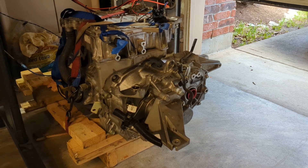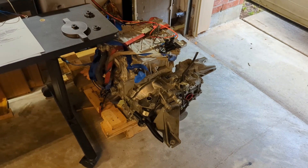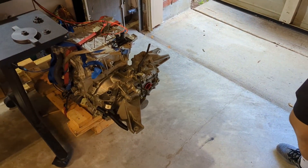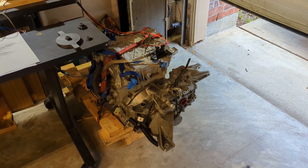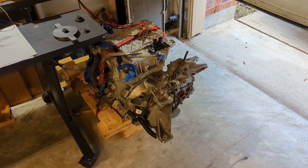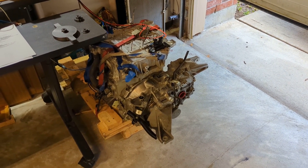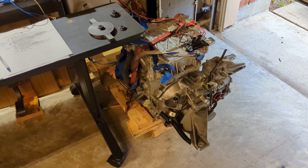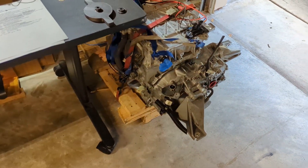The question became how do we get it out of park. We did some research on the motor thinking that if it's a simple DC motor interface, we can just drive the motor. But everything we found suggests it's not — it looks like it's some sort of brushless motor with pulses going back to the VCU or VCM of the Leaf. So you'd need something custom and complicated to drive that motor. That was out.